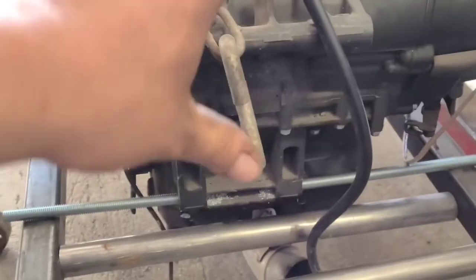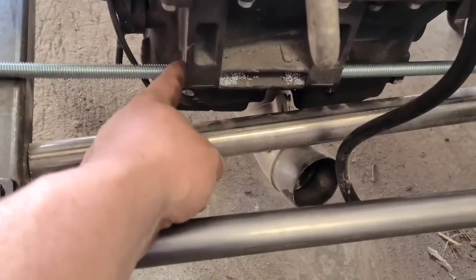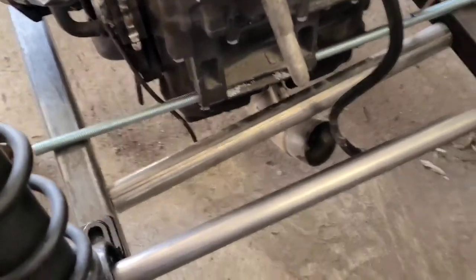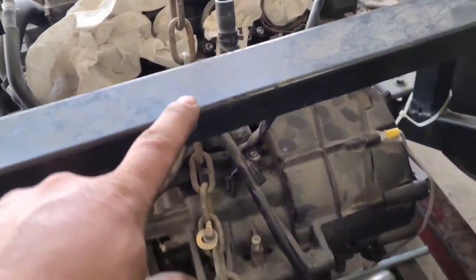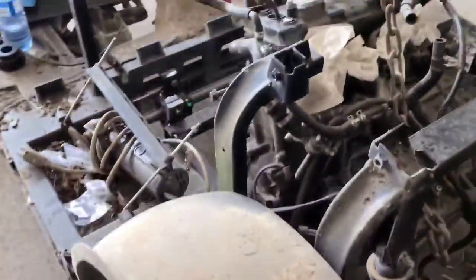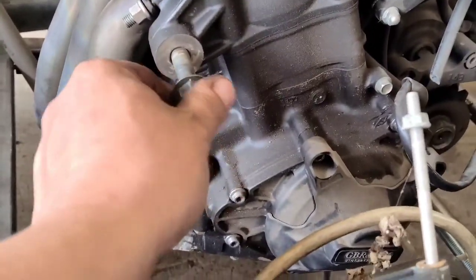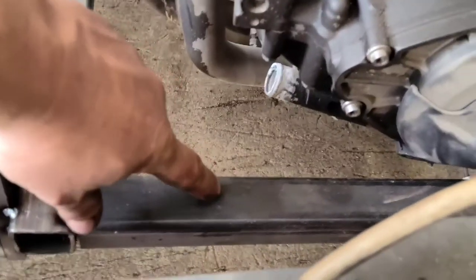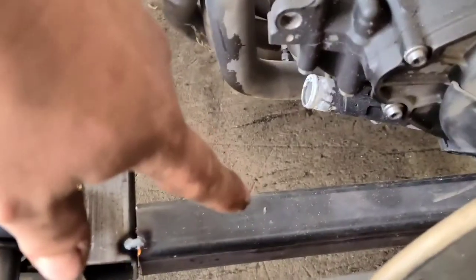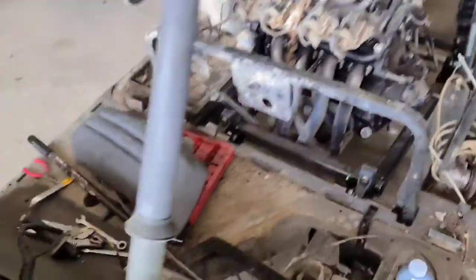So that lets me set this in here. I got this piece of tubing cut — I'll just make some ears, drill some holes that'll go from here, I can weld them to this tube. I'll get that squared up and true and then that'll be a mount for there. Then I can come off of probably this top bar, come down there to lock those ones in, and tie them into — maybe even come right to the back, stiffen that up. And then for the fronts, we've got these original mount locations here. I think what I could do is just use another piece of this tube here, come straight up as a standoff, or I could use that round tube I have as well. Then I can just go straight up with that, put a plate on it, bolt it in with that bolt, and do the same over here.